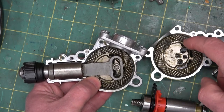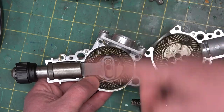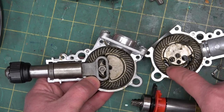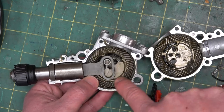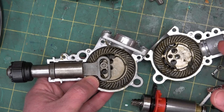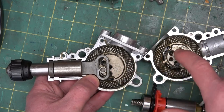So perfectly clocked together at zero degrees. Now they're counter-rotating recall, so at ninety degrees that will turn this way and that will turn that way — that takes out the up and down. But it still allows us at 360 degrees to be dead nuts on the money to take out that in and out vibration. So that's the way it's got to be: phased at zero degrees, counterweights in the exact same position.